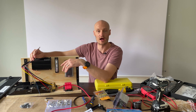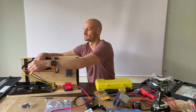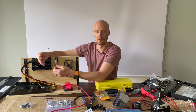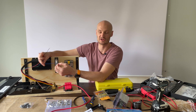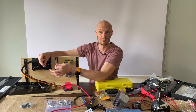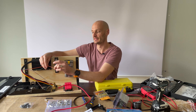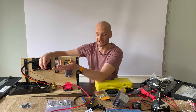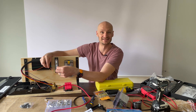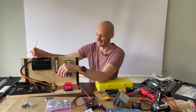The brown wire connects to the auxiliary battery, which charges it through the DC-DC charger. There are three ancillary small wires: the blue wire is an ignition wire — some vehicles drop in voltage and require it to go back to the ignition to know when the vehicle is on. You don't need to do that for a Hilux, so that wire is redundant and won't be used. The orange wire is for determining the charging profile depending on what battery you have — I'm using an AGM so that doesn't need to be connected. The green wire is for an LED indicator light — I'm not going to bother putting one on, so I won't use that wire either.